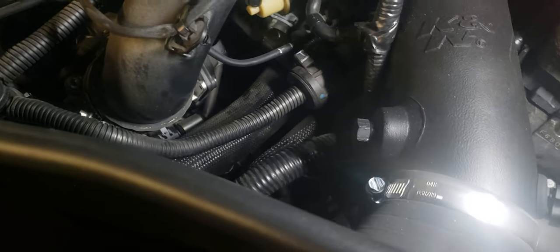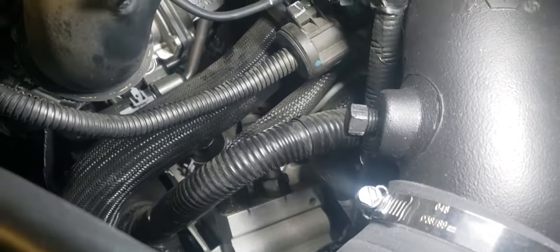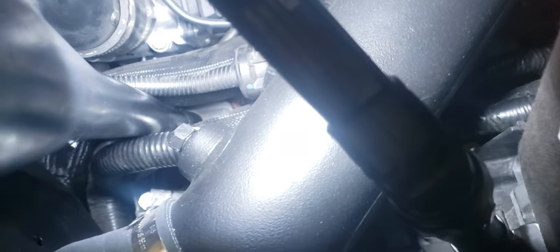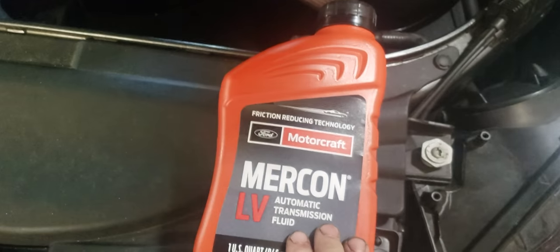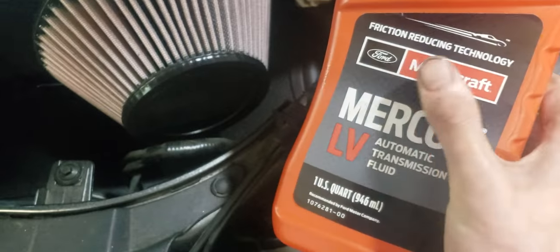I've got a total of five quarts but I'm only going to add four and a half, because just a little bit above four quarts came out. That plug is where it pops out — just like a little rubber hose. Put the transmission funnel in it and add four and a half quarts of Mercon LV. You only want to get Motorcraft Mercon LV automatic transmission fluid. Do not add anything else — these transmissions are kind of stubborn about what you put in.